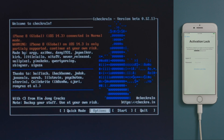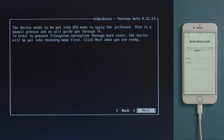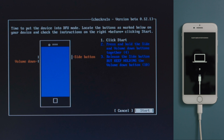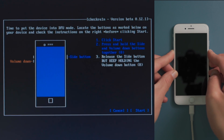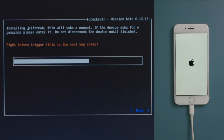Then click back. Now it says iPhone 8 is partially supported — go ahead and hit start. The device will be put into recovery mode first as insurance; press next to confirm. Once in, press start, then quickly follow the instructions to put your phone into DFU mode. For iPhone 8, press and hold the side and volume down buttons for 4 seconds, then release the side button but continue holding the volume down button for another 10 seconds. Once in DFU mode, you'll see the jailbreak code running on your device.